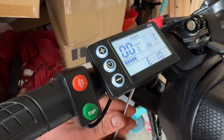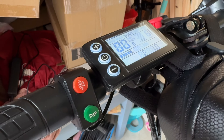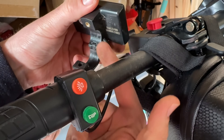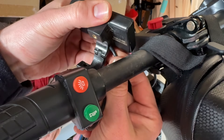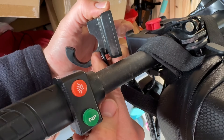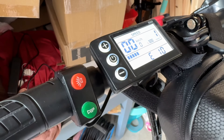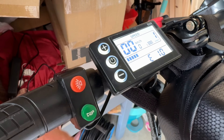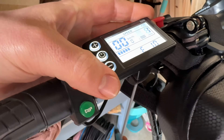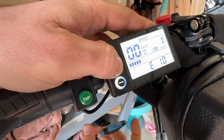We start here on the computer itself and loosen the screw to look what's going on with the cable which enters into the computer. If you have wiring problems, shake it a little bit — if it comes out, you know the failure source is there. If it looks good, get this back into position and tighten the screw again. This is failure area number one and it's fast to check.